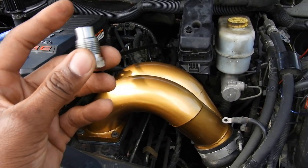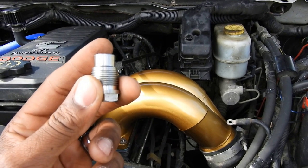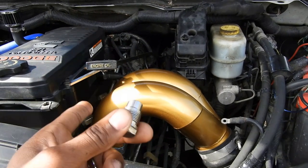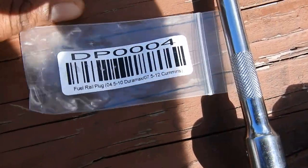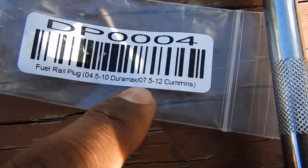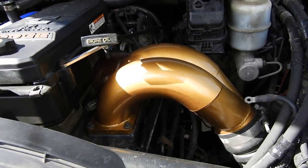It's kind of a safety feature. Unless you're pushing massive fuel — like 35,000 to 40,000 PSI — it's not going to be detrimental. For your average truck guy making a mild 700-800 horsepower, even a thousand, you're really fine. When you start getting into triple CP3 setups, that's when you might want to go back to the old one. You can actually shim the original one too. I bought this from Rudy's Diesel; it's an RDP fuel rail plug, good for '04.5 to '10 Duramax and '07.5 to '12 Cummins 6.7.